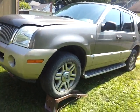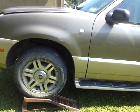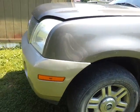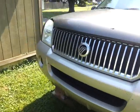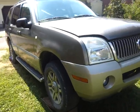Ford just can't get the torque converters right — this is the third one I've replaced. I lost first gear last night, slipping really bad, so I want to pull the tranny out and put new clutch packs in first gear and check the rest of them. I have to pull it out anyway to replace the torque converter, so I'll just do it all at one time.